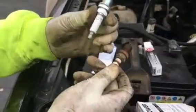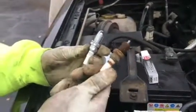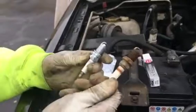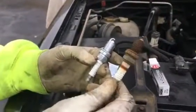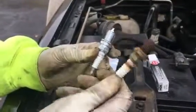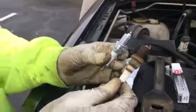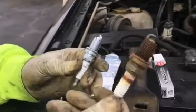Old spark plug, new spark plug. Another reason you want to change the spark plug — not just because the manual says so — is that a worn plug can actually rob your engine of power. Not enough spark getting to where it needs to carry the load. You can notice symptoms like your vehicle bogging down, not as peppy as it used to be, feeling lackluster. Poor gas mileage is another common symptom of worn-out spark plugs.